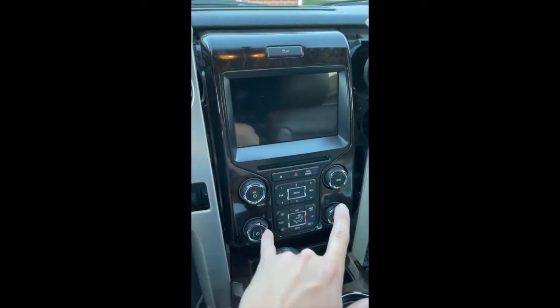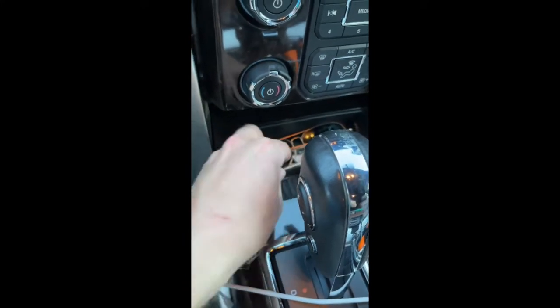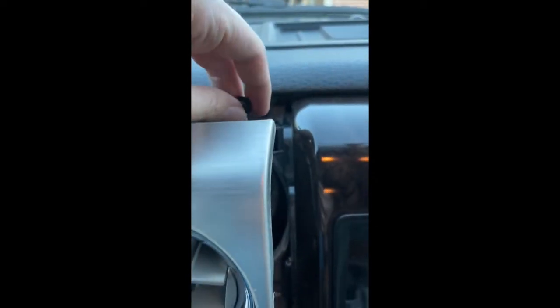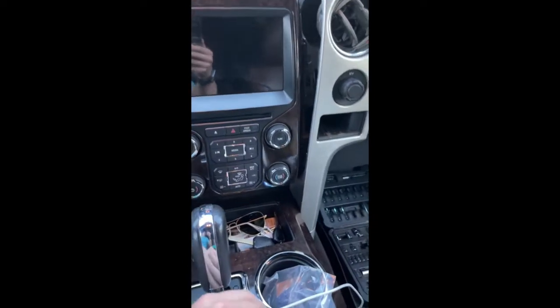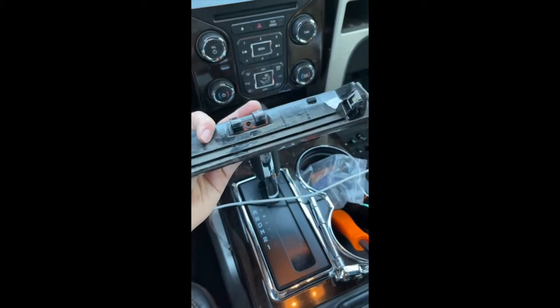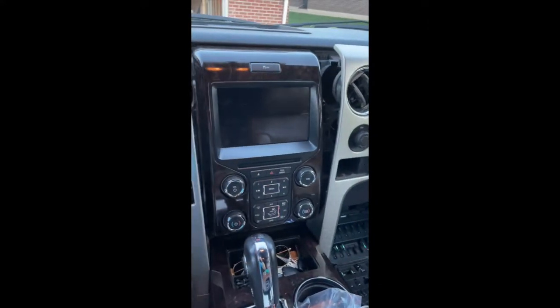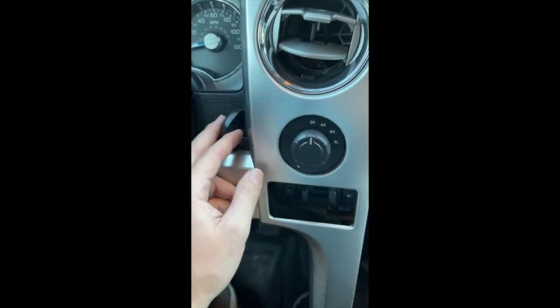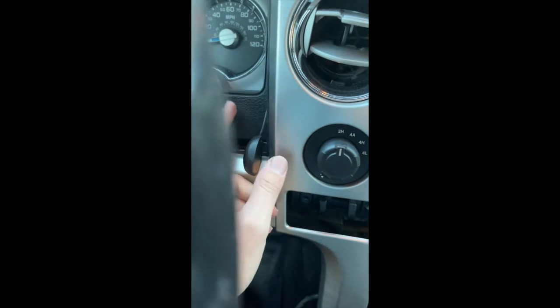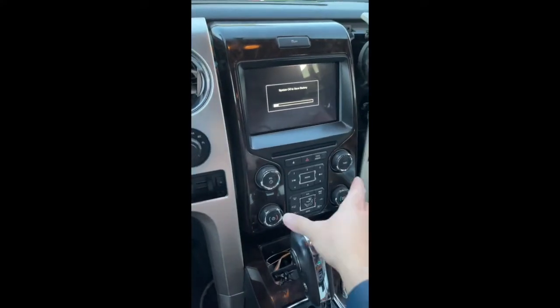I've pushed this panel into place — there are two clips down here, just push in. I need to pull both of these out for access. Just a couple of seven-millimeter screws typical for Ford interior stuff — screw those back into there and there. This piece right here has just two clips — pops underneath and into place. Once that's pushed in, route the microphone wire. I've got it going from up near the vent down to here.